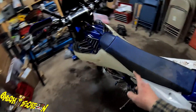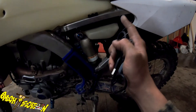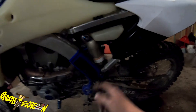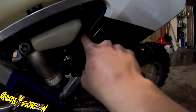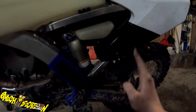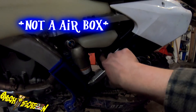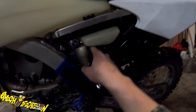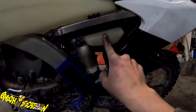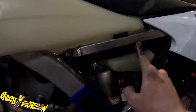We messed up and the fuel gasket is leaking, so we have to take this all back off. It ended up taking us far longer than it should have and it's late, so we have to get home. This part right here - we actually had to cut this out. There was a plastic cover that goes right here. I think the previous owner might have put a different set of plastics on this, including the airbox, that was different from the stock bike, because the instructions said nothing about having to pull this off or how to cut this off. You can see this black piece of plastic - we literally trimmed that just so the tank would fit.